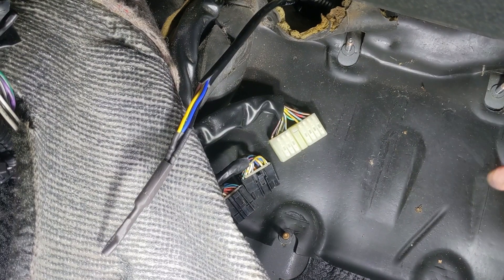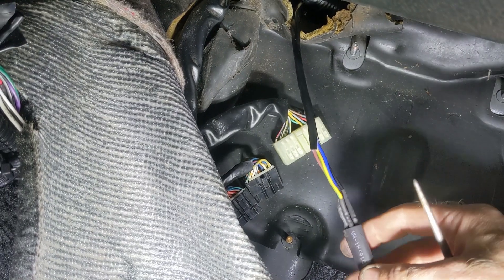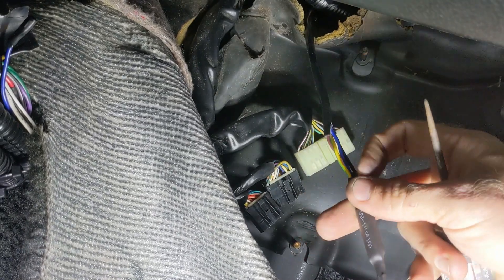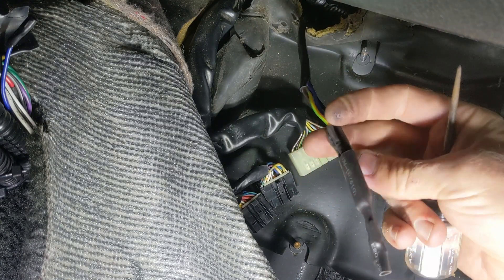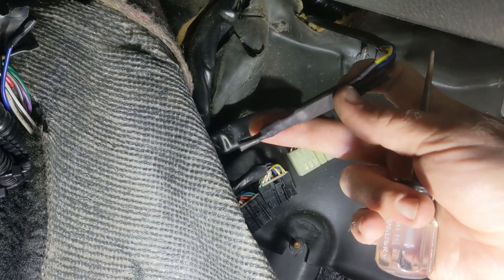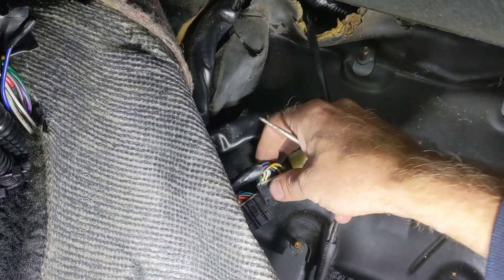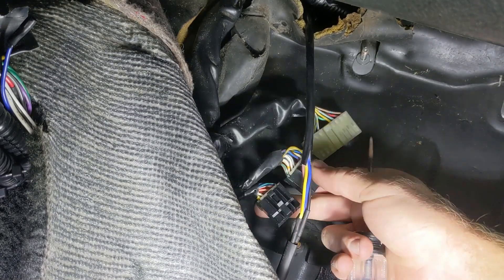This is going to be pretty difficult to show since it's really tight working space underneath the dash. But up underneath there where the ECU wiring harness comes through the firewall, there's a rubber boot which I cut a little slit in with an X-Acto knife and I fed through my VTEC wiring harness. I just heat shrunk the end so it'd be easier to feed those four loose wires through together as one piece. So I'll take this off, but the first step to getting these wires plugged into the wiring harnesses is to actually locate the A, B, and C wiring harness plugs.